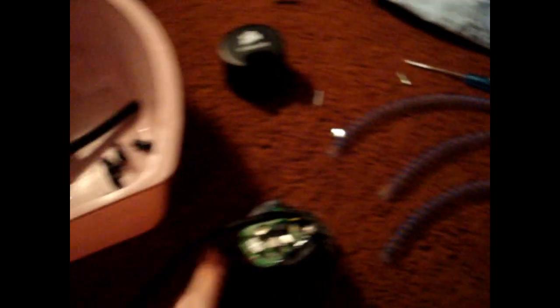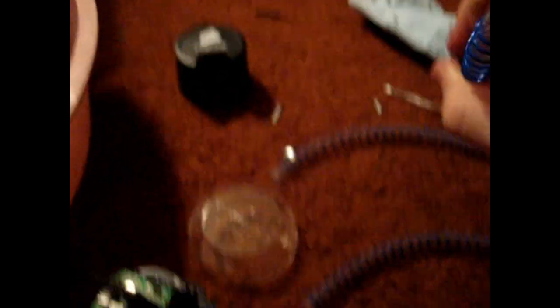I've gotten that set up. Once I get the tubing on, I will shoot up another video. I'm also planning to lap the CPU and the H50. You're going to want a quarter-inch inner diameter tubing, three-eighths inch outer diameter, because it will fit in here easier without any problems and it's going to be a tighter fit. For the reservoir, the Swift Tech Micro Res, use quarter-inch barbs as well. I didn't use the one-half or three-eighths, just so that all the barbs are the same size and I don't need any compression fittings to go from a half inch or three-eighths down to a quarter. So it's just a cleaner look as well.